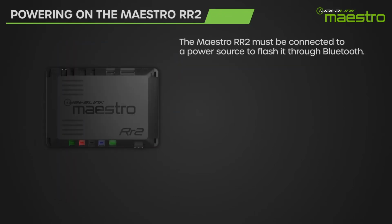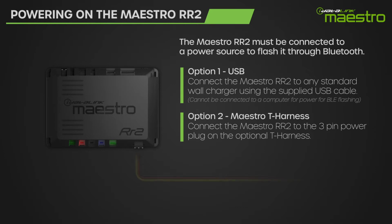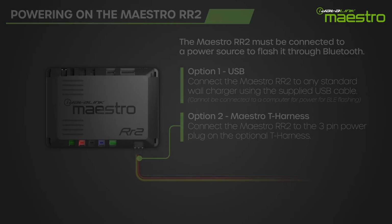Before you can begin flashing, the Maestro module must be connected to power. There are two ways of providing power to the module. The first is using the supplied USB cable along with any standard USB wall charger. The second option is by installing it into the vehicle using the T-harness. Only the larger 3-pin power plug needs to be connected to the Maestro RR2. The remaining connections should be made after flashing is complete and you have the installation guide.